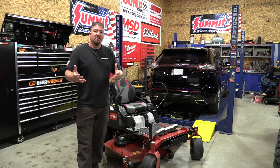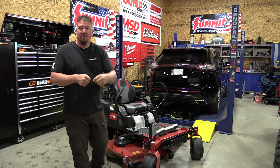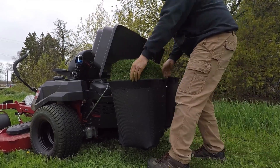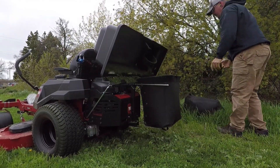I can fix that with a few modifications. In my bagging experience, even going back to a John Deere 318, that wasn't an issue — you could take those bags and abuse them trying to dump the grass. If you did that with the Toro bags you would rip the handle off. A few modifications — put a rope in there, tie a knot, use a washer on the other end — and I think that will be fine. At this point they're still working, but it's a weak point and should be noted.